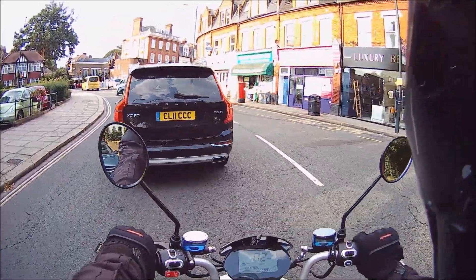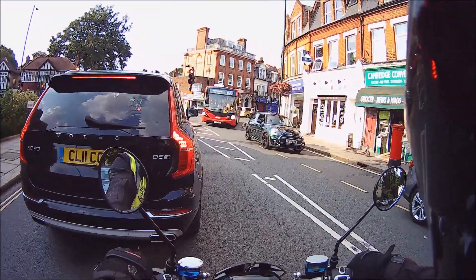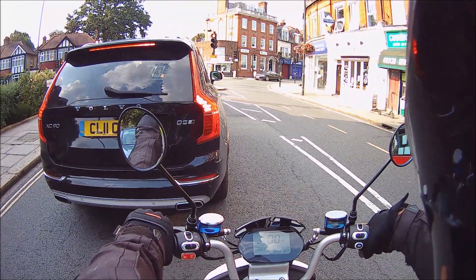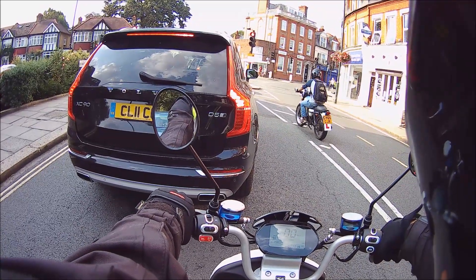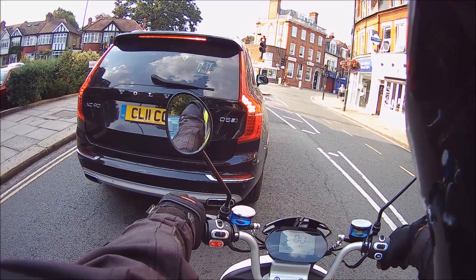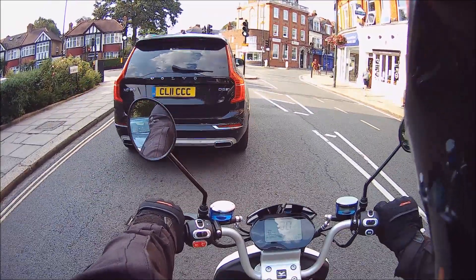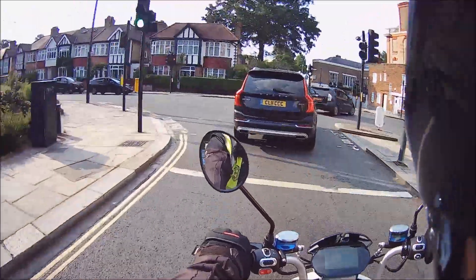You will not be riding in Mode 1. If you're riding in Mode 2 or 3 doing 20–25 mph on your commute, you're already halving that to around 50 km, which would be 30–35 miles. Then knock off another 10% and you're down to about 30 miles range. That I would believe — I wouldn't believe the 100 km figure.